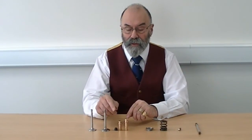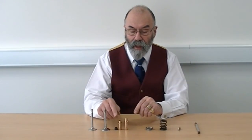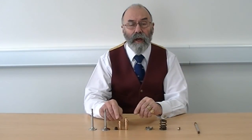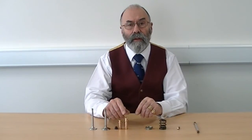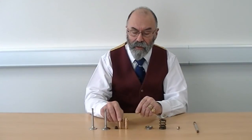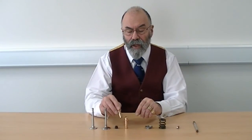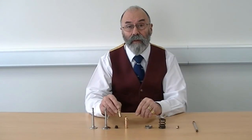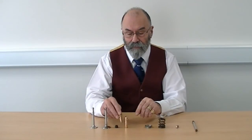Our valve guides are made from a high copper bronze. Originally the Triumph factory called it High Dural 5, often now called Colcibro. You can see from the pink brown colour that it is high in copper, and copper is a great transmitter of heat, and that's very important with today's poor petrol.